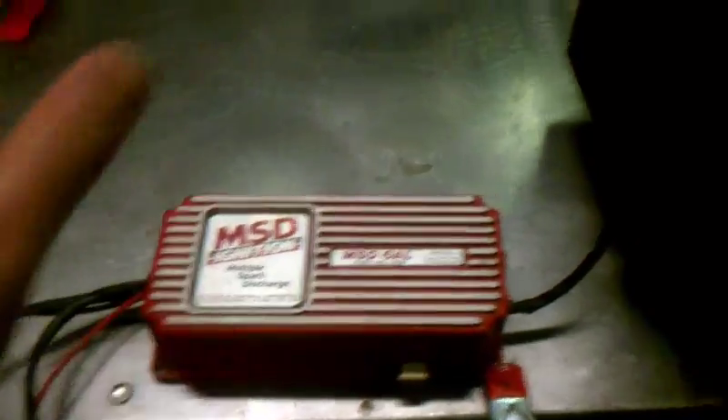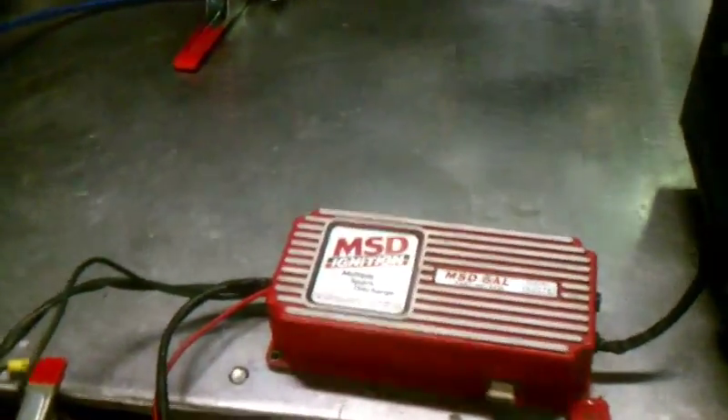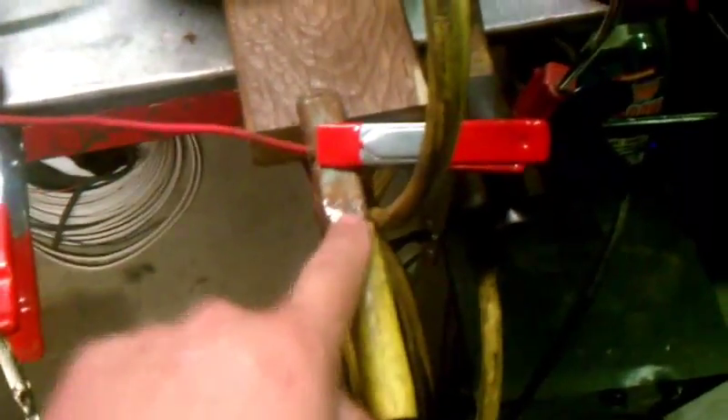What I've got here is a basic 12-volt battery, and I've got it sitting on a block because the table itself is rigged as a 12-volt negative ground, just like if you're installing it on the vehicle. So the table would simulate the frame, the body, the engine block, et cetera. I've got it grounded with a set of jumper cables to the table, then the positive going to another piece of wood, isolated from the table. Here's my constant 12-volts — ground goes to the table — and these are the main power leads to the MSD.